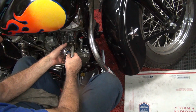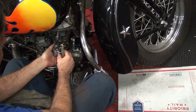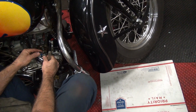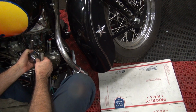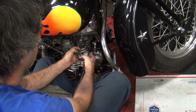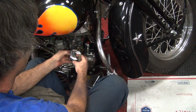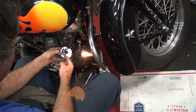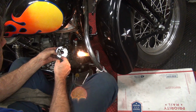Now the other option is this point is grounded because it's out of position maybe. Maybe it's off the rubbing block right now. The points are grounded, so it's grounding everything. Open the points and then try and ground it, touch it. Slid up a little bit. Oh yeah, those are open, aren't they? There you go. Oh, that's what I was shorting against. That's how points work, see? Yeah, that's not grounded there. The points are hooked up now. It's grounded to the points.